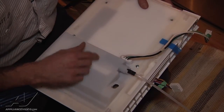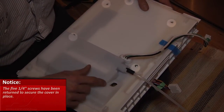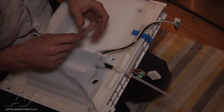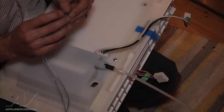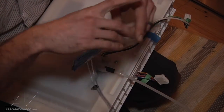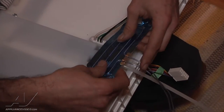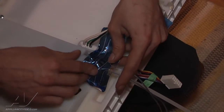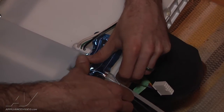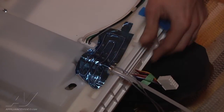At this point, if your icebox does not have the updated fascia heater kit with the through hole, you're going to have to replace the top cover. But this one is updated so we do have the through hole, so we don't need to replace the top cover. We're just going to install our fill tube heater — peel your backing off. You've got this tab here that's going to go up towards the front.